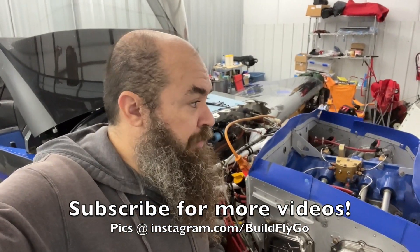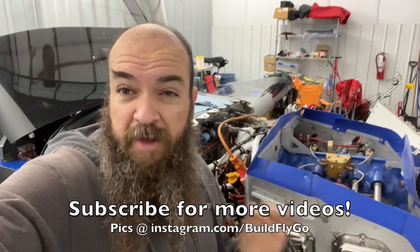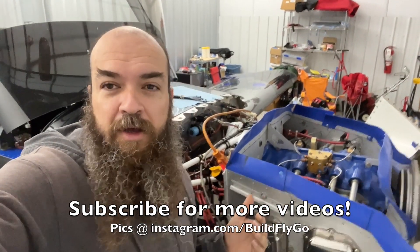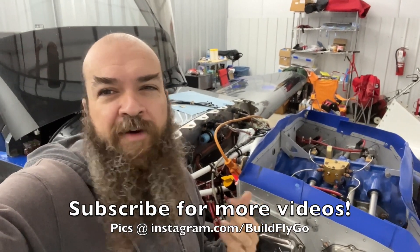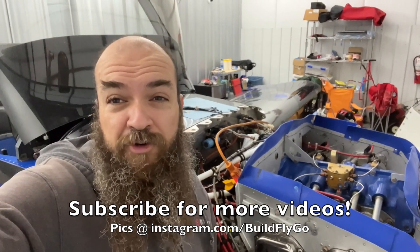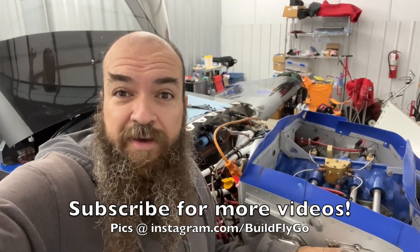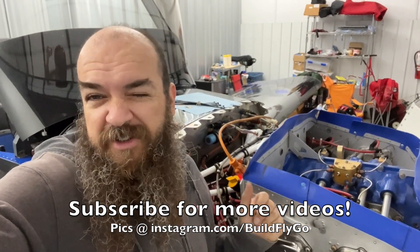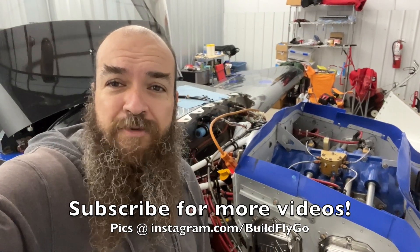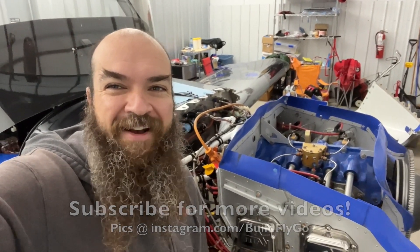So we've looked at our use case and how we've used the aircraft over the last five years. We decided a system that we just plug in and forget — that puts the right amount of heat, the right amount of power into the crankcase to keep it at the right temperature — works better for us. Don't have to worry about a cell phone switch, Wi-Fi, or turning it on in time — no more arriving and realizing you forgot to turn on the engine heater and needing to wait two hours. We reached out to Tannis and they very nicely offered to put a system into the RV9 and RV10. Feel free to ask questions — there's no paid placement; I only reach out to vendors I want to work with. Thanks folks, we'll see you soon.